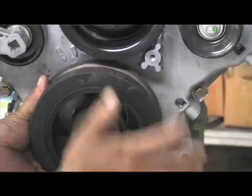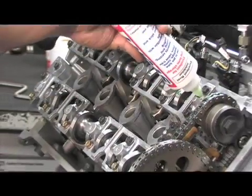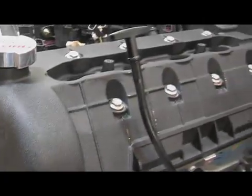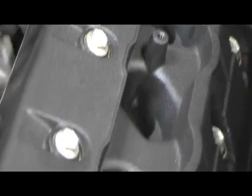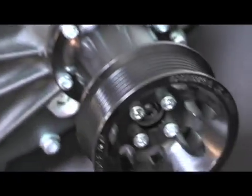I finished up the front part of the motor with the dampener, so I'm just going to oil up the cam and then seal up the valve covers. That finishes the 4.6 and we're all through. FPS installed a set of black wrinkle-finish valve covers to match the new supercharger, and the long block assembly was complete.